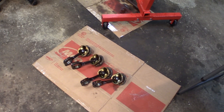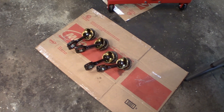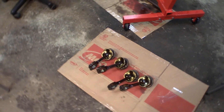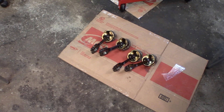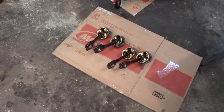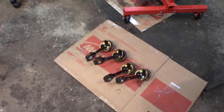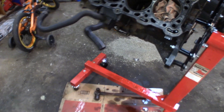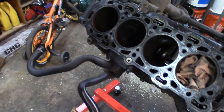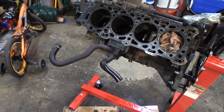I'm going to go ahead and bag these pistons up and number them, because they don't have numbers on the connecting rod journals. All the engines I've ever built before have the connecting rod journals labeled — stamped with the cylinder number. These aren't, but I know the orientation by where the markings are on the side — there are little O's stamped in it. I know that the side of the bearing that has the oil port faces the exhaust side of the engine, so I can get those all back in the same way. I'll probably do a little minor cleanup with some brake cleaner and clean this gasket surface off for the machine shop.